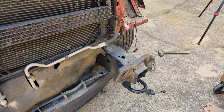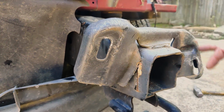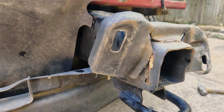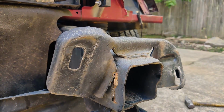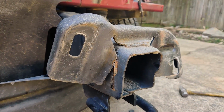And there. Look at that. Now, check that out, everybody. So it looks like all we're gonna have to do is replace this bumper collar. It doesn't look bad at all, really. No, the frame rails look great. It looks like the weld snapped right here. Yep, on this side, which is good. Then we'll just cut this weld with the plasma, cut this weld with the plasma, pop new ones, grind it down. Off we go. Cool. Let's do the other side, Ryan.